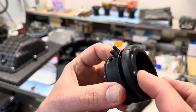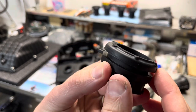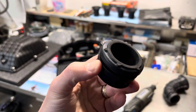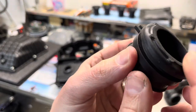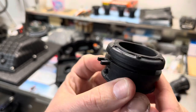You want to get it as flush as you can. I just left a little bit of a ridge or lip, but you want to cut that flush and then smooth it out. You can use a file, sandpaper, whatever. I actually used the wire wheel on my bench grinder and was really careful with it.